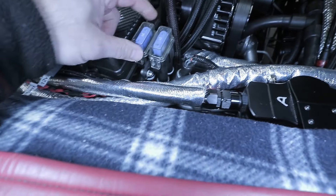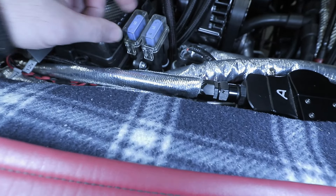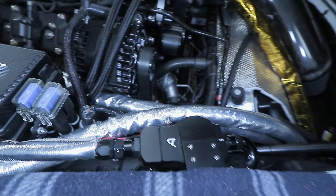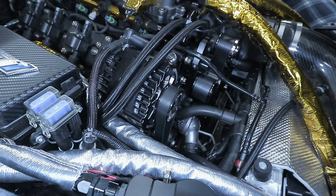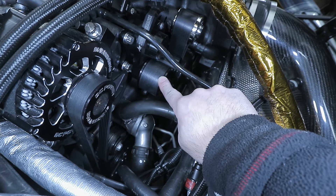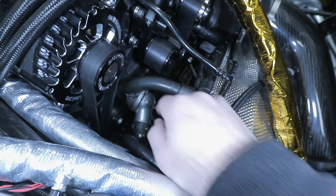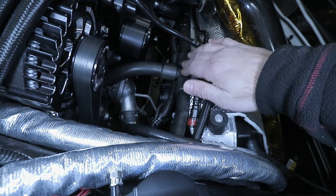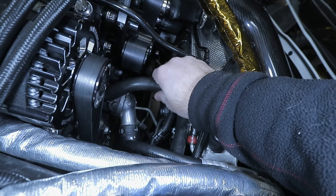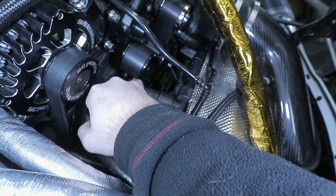Just a quick sneak peek of the latest projects going on here. I finished up my upper intercooler tank, which is fully insulated with foam and heat wrap. I also added a larger opening and lid to run ice, and there's a drain fitting below. All I have to do is drain it, fill it with ice, and go. Also, this right here is a speed controller for the intercooler pumps so I can fine-tune them — down to around 30% or 40% — to find the optimal balance point. Slowing the pumps down actually cools better than running them at 100%.